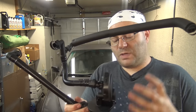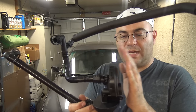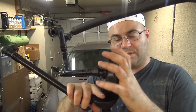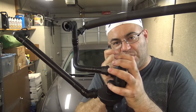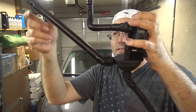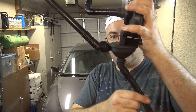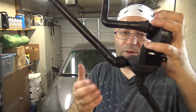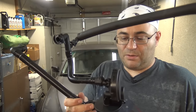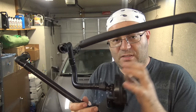The reason that's bad is because that diaphragm is not normally held all the way closed. Normally, there's actually a spring inside here that's pushing the diaphragm out. Engine vacuum wants to pull the diaphragm closed. That spring is holding the diaphragm open just a little bit so that only a little bit of vacuum is actually making it into this chamber and sucking the vapors up. If there was full engine manifold vacuum applied to this chamber, some of your oil would get sucked up this tube from your oil pan and actually be burned inside of your engine, which is not good. So that diaphragm is there to regulate the vacuum down so that it's not so intense.